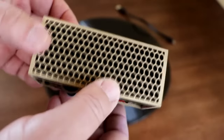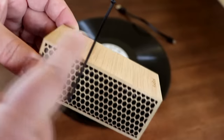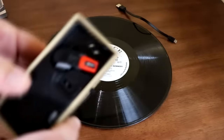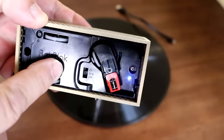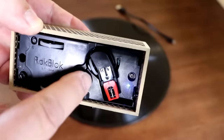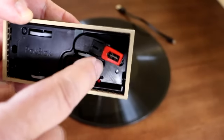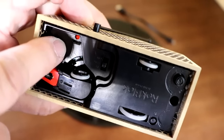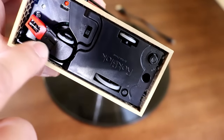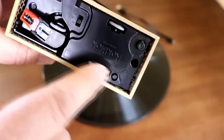It's a faux wood box that looks kind of cool. There's a lever — this is the play and stop lever. Underneath we have the power switch: bottom position is off, center position is 33 and a third, top position is 45 rpm. There's a little status indicator to show you it's on. Over here is the jack for the mini USB and a charging status indicator as well. There's the needle assembly, a little guide wheel that pivots, and then the drive wheels.